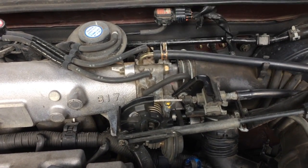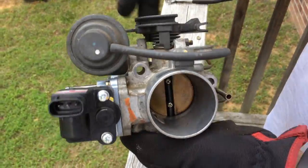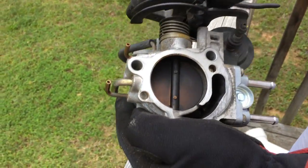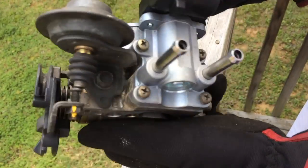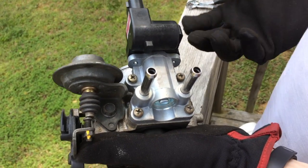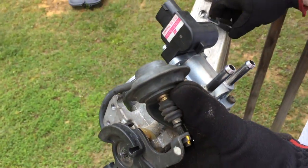This one I've already fixed — it's back on the vehicle. Let me show you the real meat of what this video is about. This is the throttle body assembly removed from that vehicle. It had a P0505 code; the throttle body was cleaned extensively and a brand new Toyota-branded idle air control valve was installed, but it still got the code. It turned out this was the wrong unit for the computer — a California emissions throttle body paired with a federal computer. Someone previously put the wrong one on, and that led to the code.